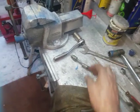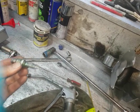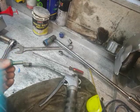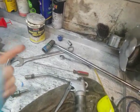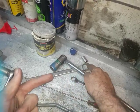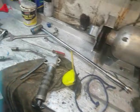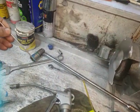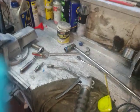Why am I telling you these trade secrets? Because I'm getting older and honestly I don't want to have to come out to your boat — you could be in a different country, and it's really difficult to take the engine out and send it to me in the UK. So now you know the techniques: first, Dynastart; second, 24mm ring spanner on the flywheel nut; third, 24mm socket with a longer extension bar; fourth, crowbar carefully in the flywheel webs; and finally, if it's less than 90mm deep, the hydraulic spark plug technique.